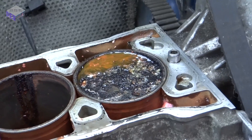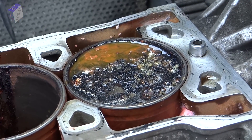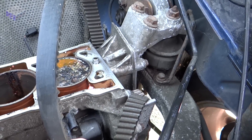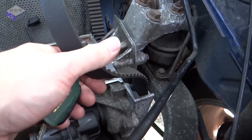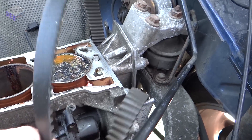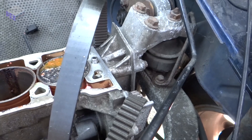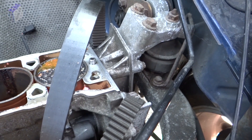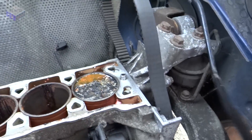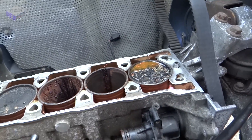It was that piston there that had hit its valves. The belt is okay — absolutely fine. It was a brand new belt, but the pulley that tensions the belt up had a loose bolt. So it slipped off its tensioner, the cams slipped, and then the valves met the pistons, which isn't a good idea.